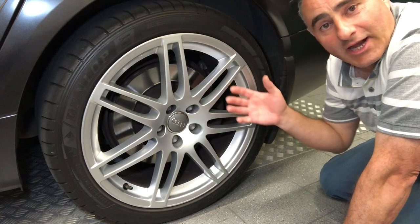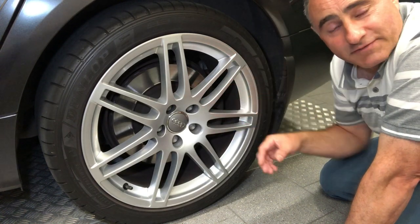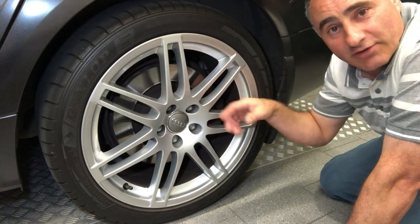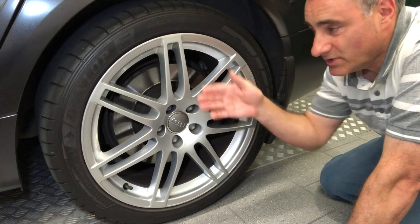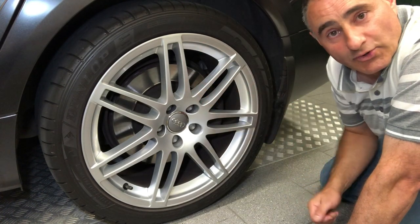And that's my simple alloy wheel protection method. As you can see, I like to keep my wheels clean. I like to get that brake dust off as soon as I can. Because when you're travelling, the wheels do get hot. And if you don't wash that brake dust off, over time it'll just bake into the wheel and ruin the surface — you'll get yellow areas and black areas, and it'll totally ruin them.